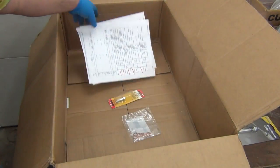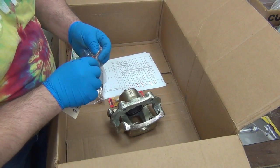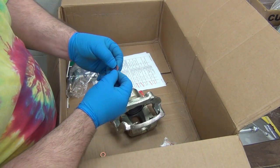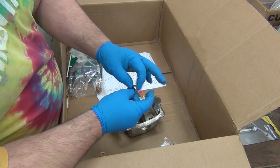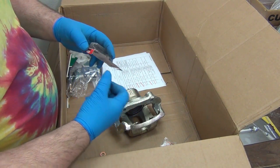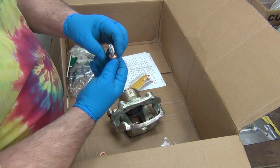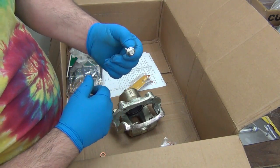Let me grab one of the calipers. These are the ones that came in, the ones I ordered. They're basically the same thickness, and we're really only concerned with the ID being the same. Yeah, that's the same. The extra width — my thought would be that the narrower one is going to compress a little easier and better and conform to the surface around it. See, that fits perfect, and it's the size of the head.